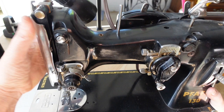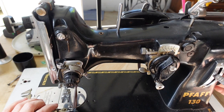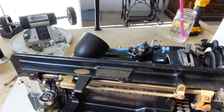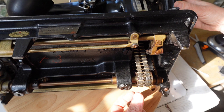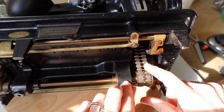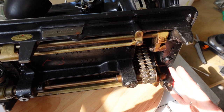There's a mad scientist light here that wants to come off, so I'm just going to set it down. I'm still up in the air about how I like that light, but we'll deal with that later. She does have the cogged belt down here — it's very stiff and very oily. When these are old and oily, it can compromise the strength of the nylon in there and possibly make them more prone to breakage. I really hope not because this would be very difficult to replace.